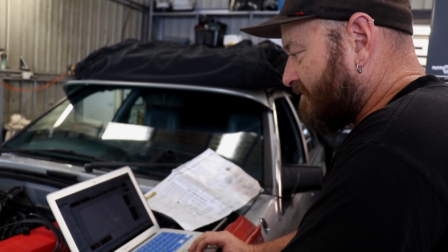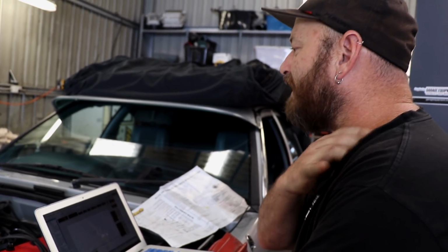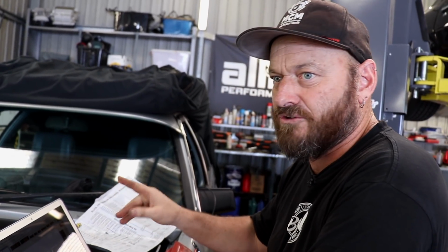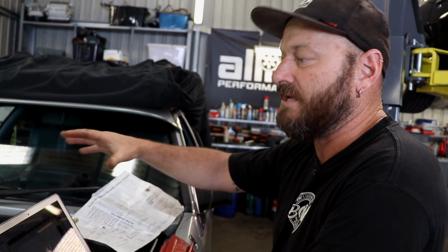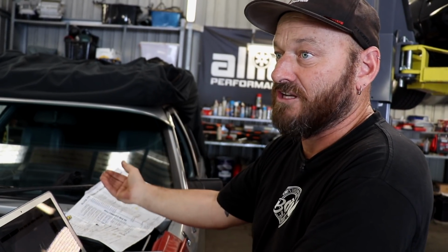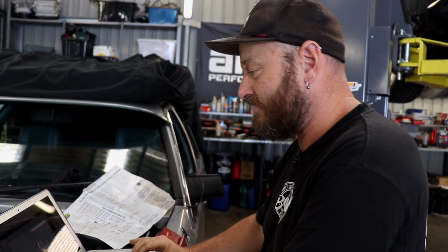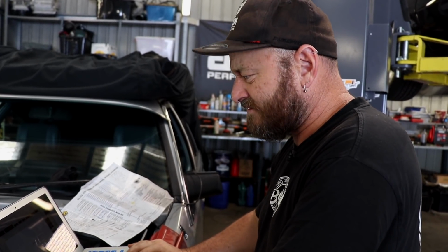Got all the sensors configured, everything's working okay. Had a problem with the coolant temp and air temp sensor not reading correctly. They have the option of having a pull-up inside the ECU or not, and that's for if you are piggybacking that ECU onto another engine. The pull-up is in the original ECU, so I just had to select them and that's fine. Just a little trap for old players like me. I should know better.